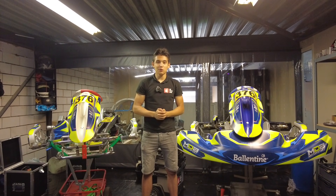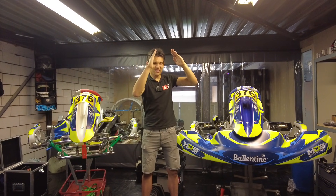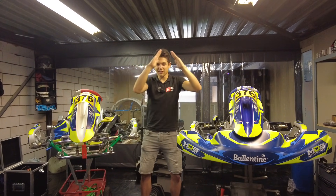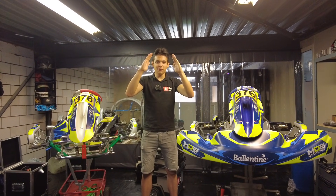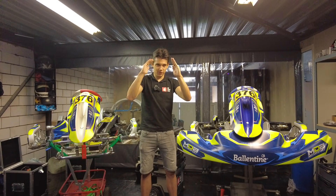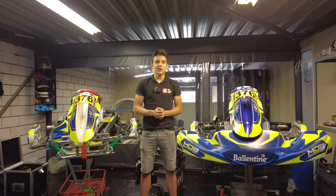There's a general rule of thumb: if you add negative camber to your kart so the wheels tilt inward, that gives more grip in the corner sideways, but less longitudinal grip. You can expect the kart to be a little bit more stable in turning but have a lot more grip in the corner. Doing the opposite will of course have the reverse effect.